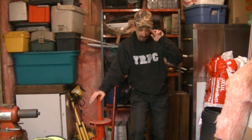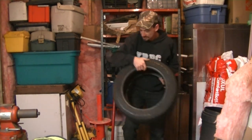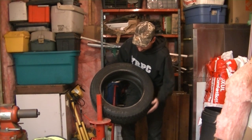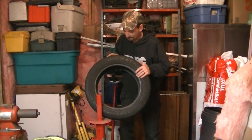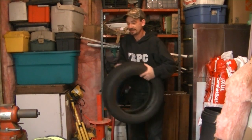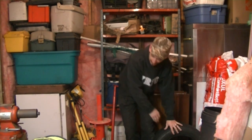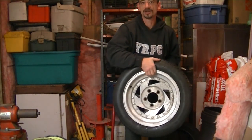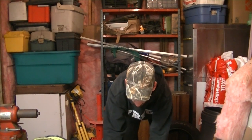I was having a hard time finding what I wanted on Kijiji for a reasonable price. On my last road trip I pulled over to get a coffee and saw a pair of tires being discarded that looked pretty good. What I ended up with, for free, was a pair of Uniroyal Tiger Paw touring tires, size 195/55/15. They're a lower profile, which is what I wanted to bring the trailer down a little bit, and they're wide enough to work with my 15 by 7 rims. Not bad for free — there's a lot of tread on these things.